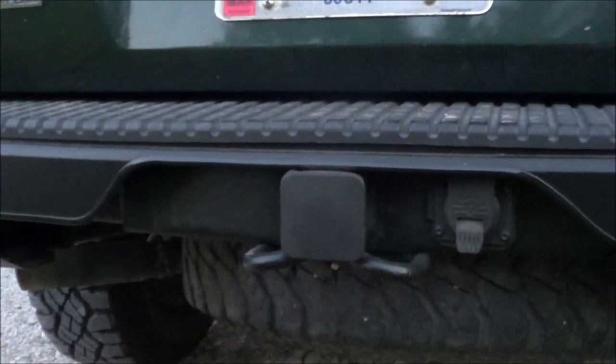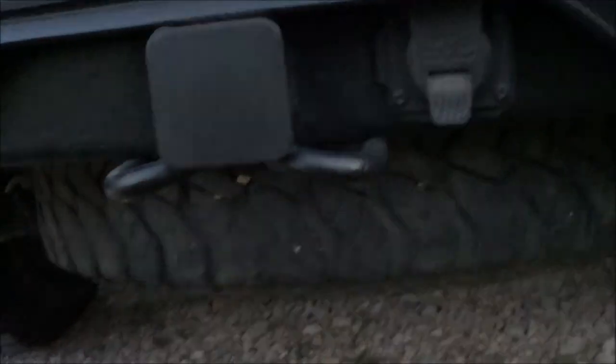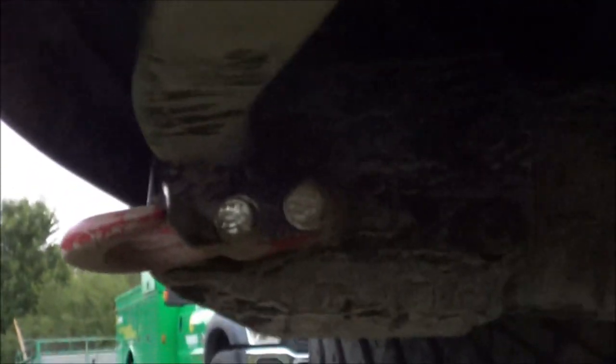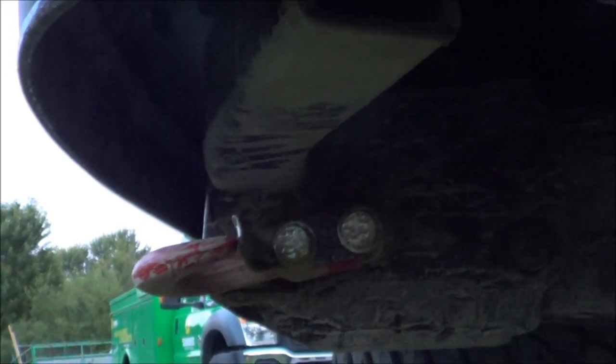I flipped it over, cut off these mounts, and then welded them back to the underside — the new underside. I had to come in here — and I'll try to show you guys the best I can, though if you check yours out it'll be a lot more self-explanatory. Two of these bolts lined up. I had to make the holes just a little bit bigger on the bumper bracket so they would line up. There's a third bolt up in here and everything's painted black now and dirty so it's hard to see. I did have to drill those holes into the frame rails for them to line up.